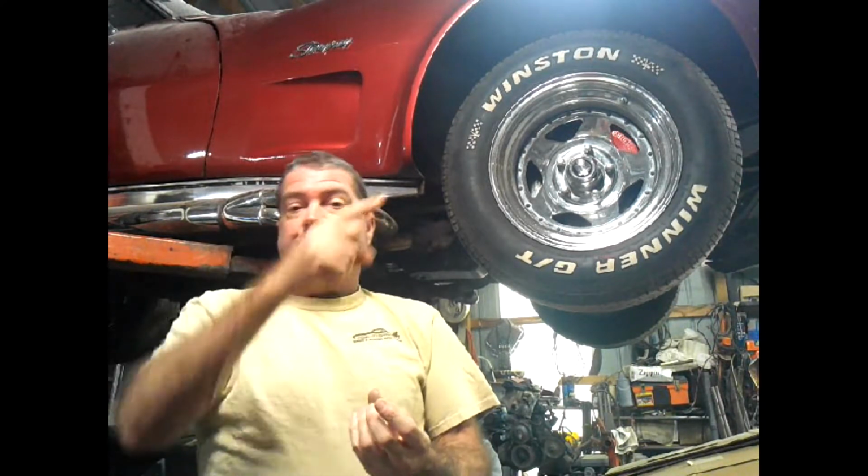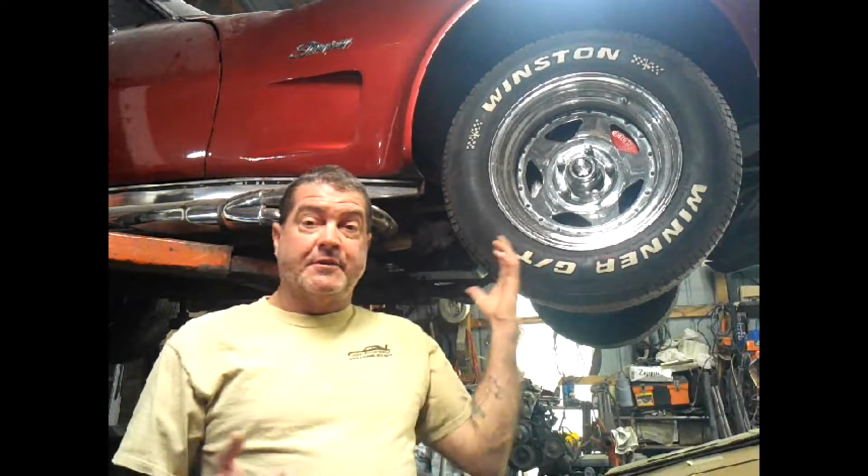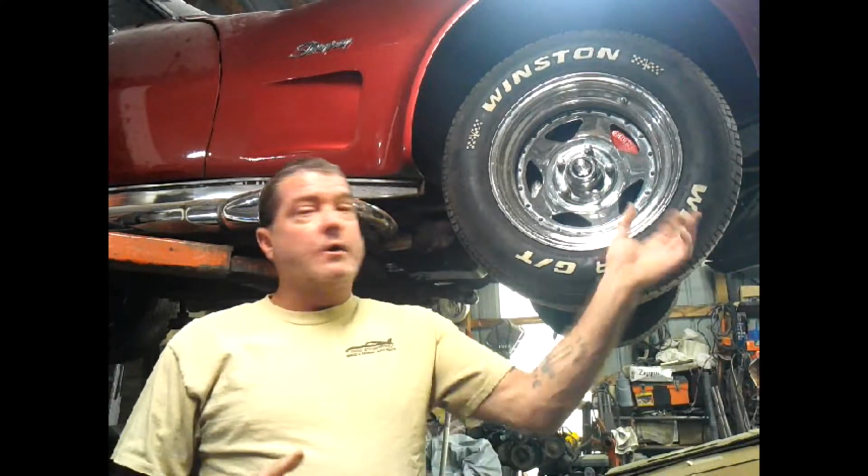And once it's full, it's going to fill it very slowly. Once it's full, then it's going to start dripping out. So it really won't even drip out until it's full. And there's not really any air there at that point. So that's a very long process. If you've got a day where you don't need the car, you've got it just sitting on jack stands or on a lift or whatever, you can do that. You can gravity bleed it. So I'll just open that up, walk away, work on some other projects, and come back every couple of hours and check on it.